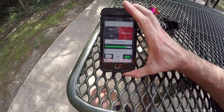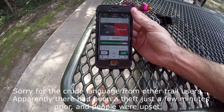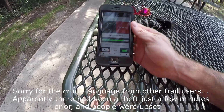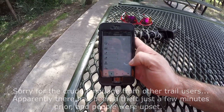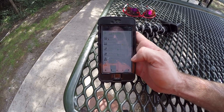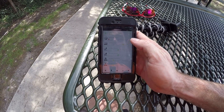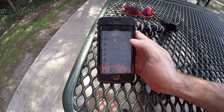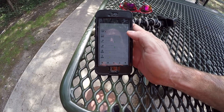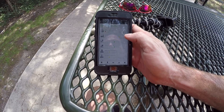Here are our numbers: 106 PSI was the preset for the front, the initial score is 82 points, confidence interval is 79%. Let's take a look at the suggestions — baseline air pressure says remove air, quite a bit. Air spring ramp — I don't quite understand that one — but it says add spacers, so I'm going to have to put some air in the lower chamber.